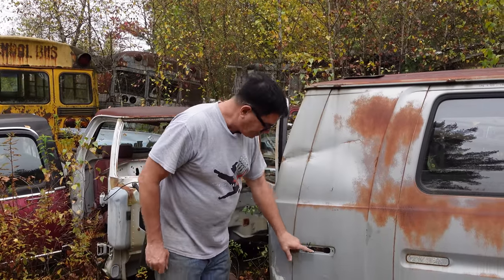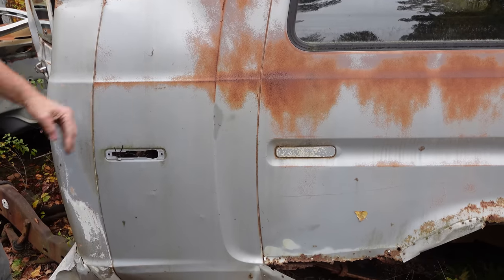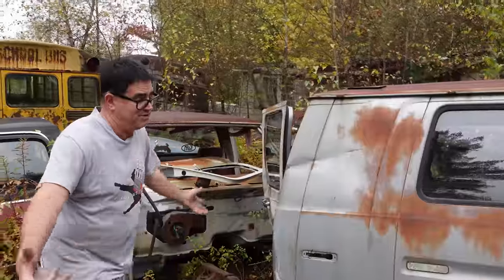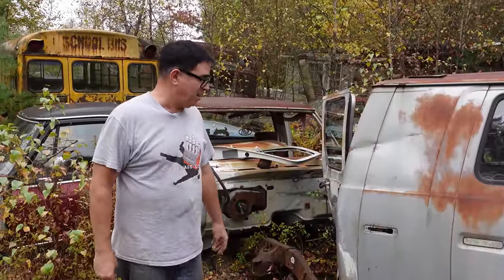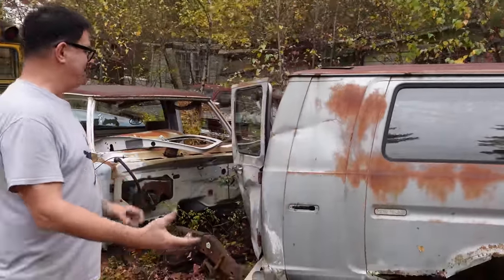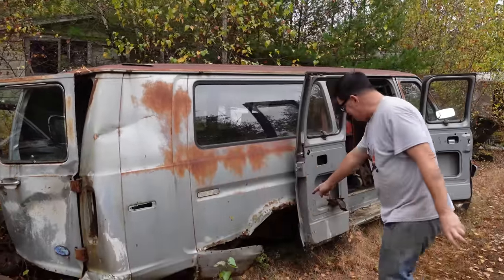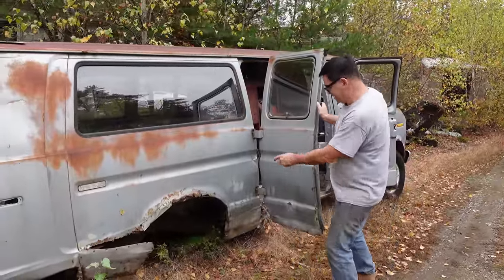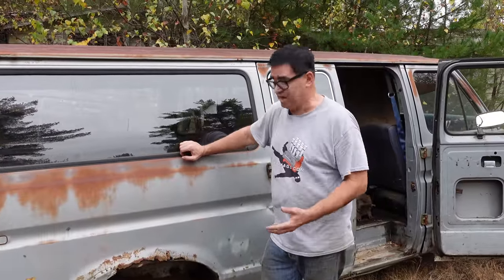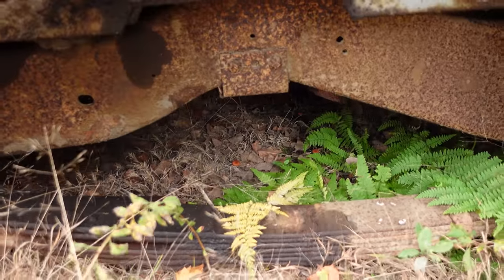The only thing that's kind of weird about these is we can see how the federally mandated side marker light is here — but what's that thing doing? Well, that's a block-off plate because the same stamping was utilized for the standard-length body and the extended one. So instead of having a special piece without this stamped into it, they just put a block-off plate on it. Mass-producing vans was about monetizing and increasing the profit margin — to come up with a different stamping just for aesthetics wouldn't happen. This one being an E250 would have had a Dana 70 rear axle underneath here, with a massive leaf spring with what looks like nine leaves on it. This is body-on-frame, whereas Dodge and GMC and Chevrolet vans at this time were still unitized — there's that frame sitting down with the body sitting on top. That's basically a Ford Super Duty pickup truck frame underneath this E250.